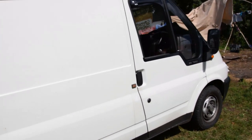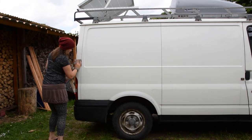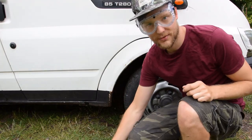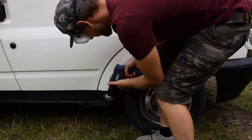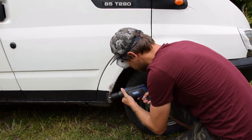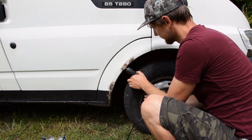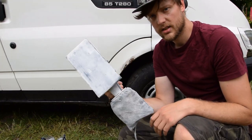The other side of the van is so bright it's awful to look at, so I'm really looking forward to it being green. The green side looks so finished and complete compared to the white side. Another useful tool for getting the rust off is a wire brush attachment that fits on the end of a drill. It says wear eye protection on the back — I probably should. So I'm going to use that to take the majority of the rusty bits off, then once over with 180 grit sanding wheel followed by 320 grit to give it a smoother finish and key the body for the paint.